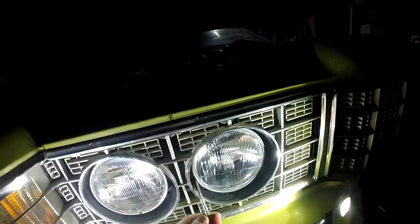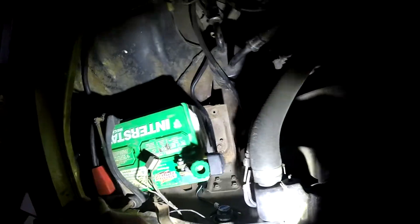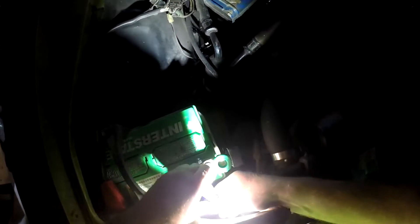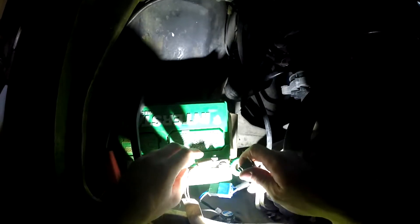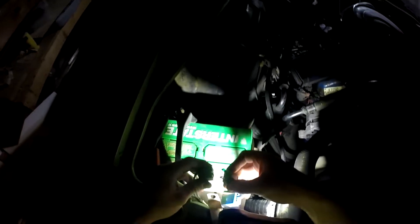I'm going to go around the headlight evenly, making sure I get the screw snug but not too tight — I don't want to break this steel ring. It's mounted securely. Here's the high beam socket — it's got two prongs, and the LED has three. So I plug my three-prong into the three-prong of my adapter, then I'll do a quick experiment to see if it works both ways. That one works. I'm going to flip the plug 180 degrees — and it does work. So there's some reverse polarity magic in there. The LED stands for light emitting diode, and diodes only let electricity through one direction, so somebody did some magic here. I'll go ahead and change the other three.